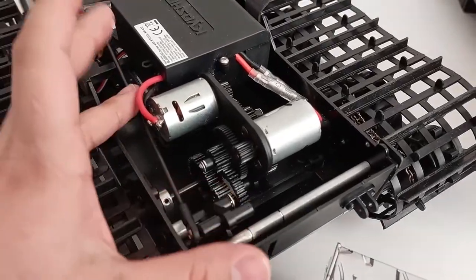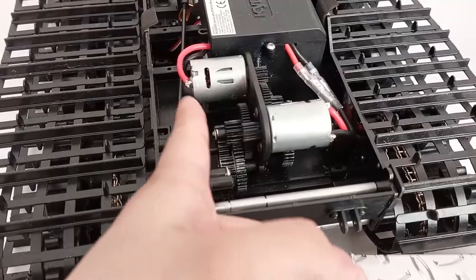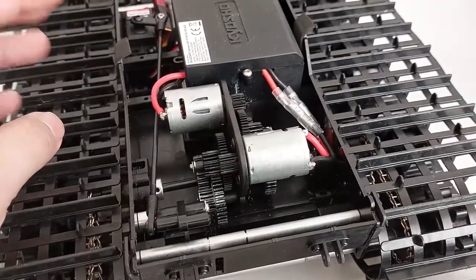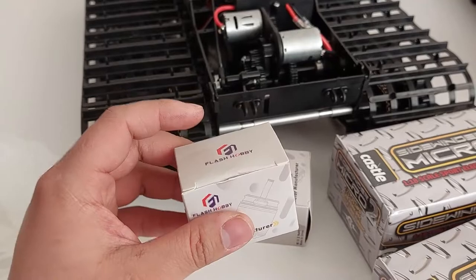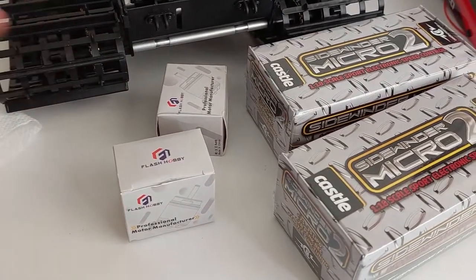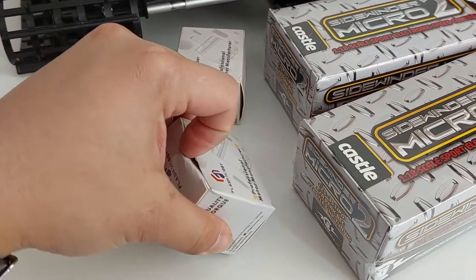The main reason for going with outrunners is that the space here, especially for the blade, there's not enough clearance and it'll run into things pretty readily — although there are plenty of mods out there to remove that, I just didn't want to bother. Also, outrunner brushless motors do a little better for startup and low speed compared to inrunners.